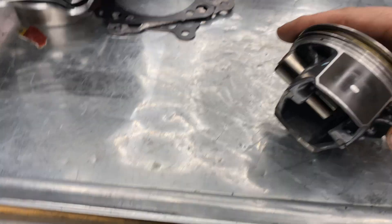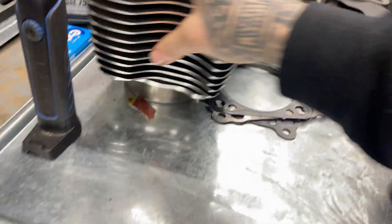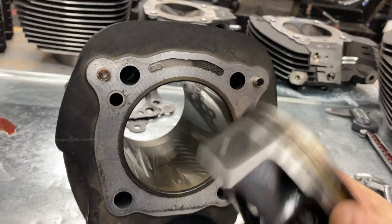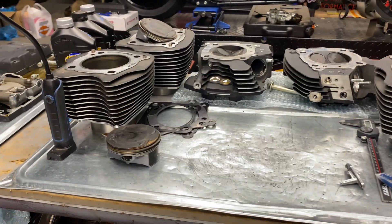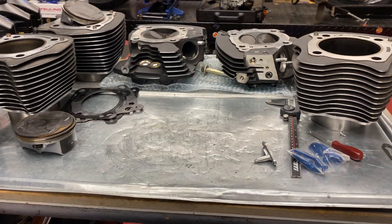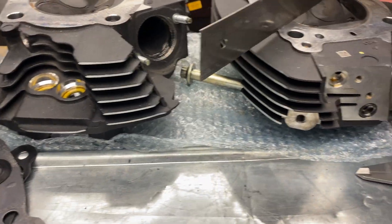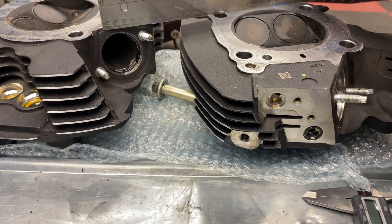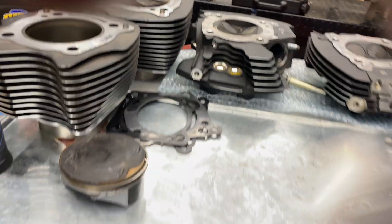If our engine was to be hot, we would see a lot of this damage going on — like in Robbie's bike. With heat, we would see expansion leading to a creation of thrust grab on rotation when the crank's going around, and we'd see a hell of a lot more damage. I didn't get to pull that motor down. On teardown, there is inspection and correction. Our flat edge on the head — usually about 5 thou difference — we run a machine across that, it's back to zero, on the money.